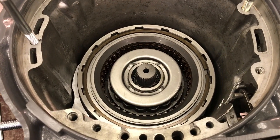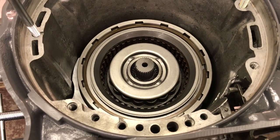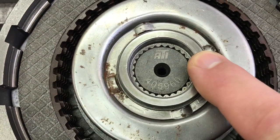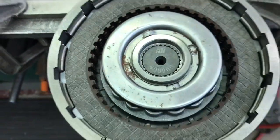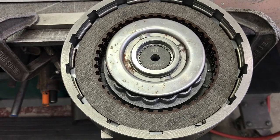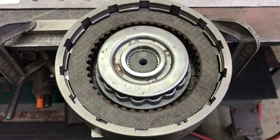Final word on the direct drum — I had cut the piston to 600 thousandths when I put in the six clutches and six direct drum steels, the thicker ones. The forward drum is an ATI — it has their larger shaft with bigger splines. Excuse the rust, I've got to clean that up — this is just from sitting for a month; I did not put rust preventative on it when I assembled it. It contains the same six clutches I used in the direct and six 77-thousandths steels, and reviewing the video from last night, I cut the piston to 582 thousandths.